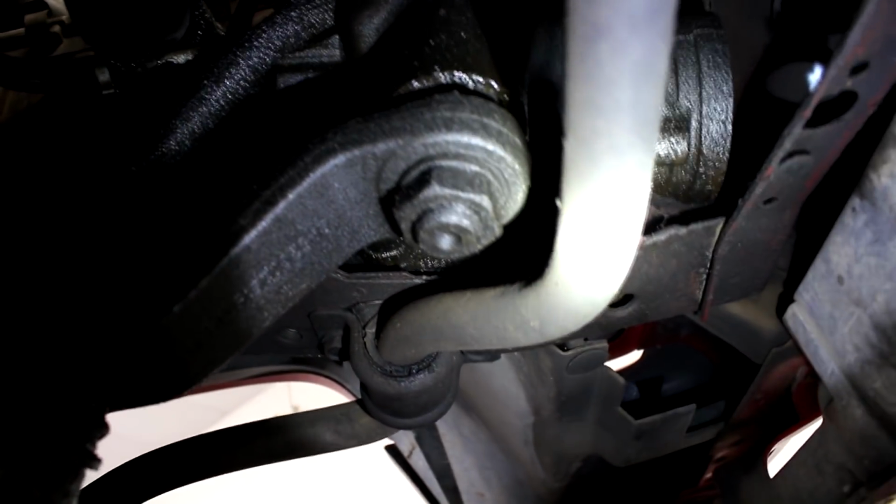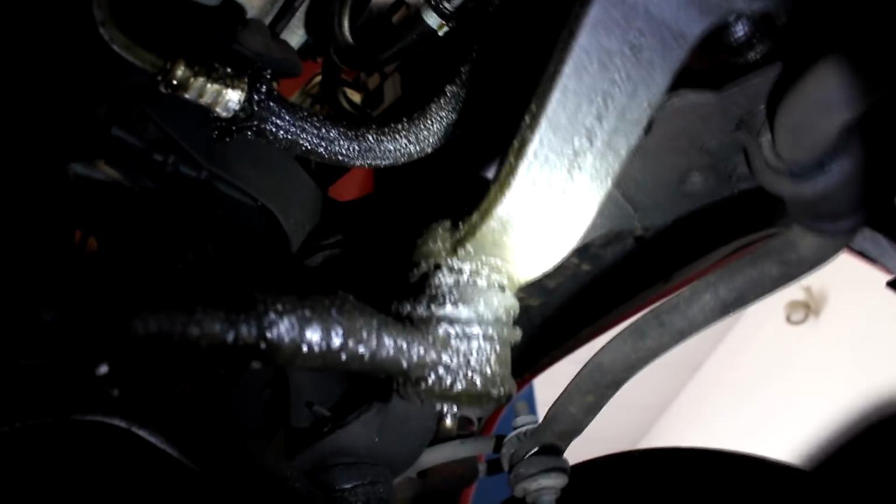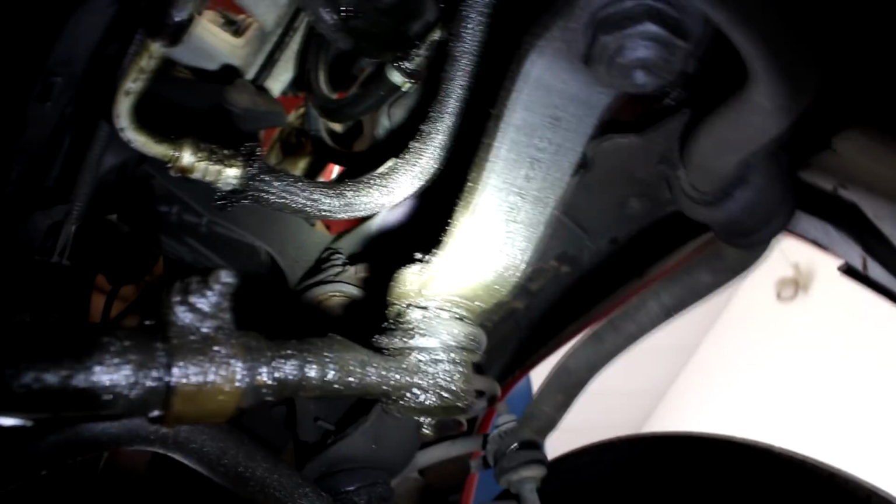We'll see. This steering box is leaking as well. It's actually leaking right from the end right in here. And that shaft is loose. I checked it out the other day, and that shaft actually has some play in it, as well as the joint here going into this pitman arm. So I will do my best to show you guys a little bit later how to check the front suspension on this thing, because these Jeeps, if you actually drive it like a Jeep and take it off in the dirt once in a while, you're going to be wearing through your suspension components a lot faster than if you're just daily driving a car on the highway every day. But in any case, that's definitely a cause for concern. We need to make sure I'm not leaking that much fluid all the time.